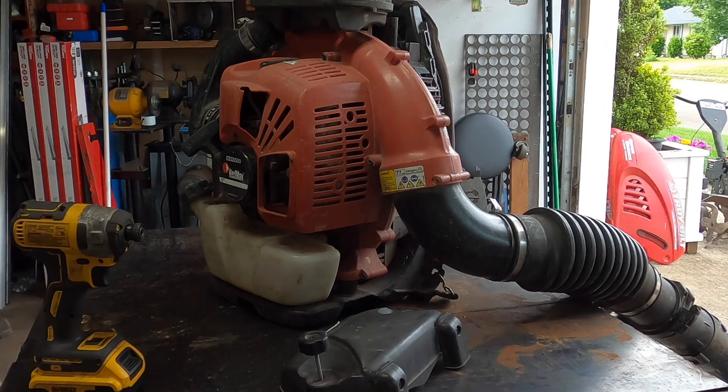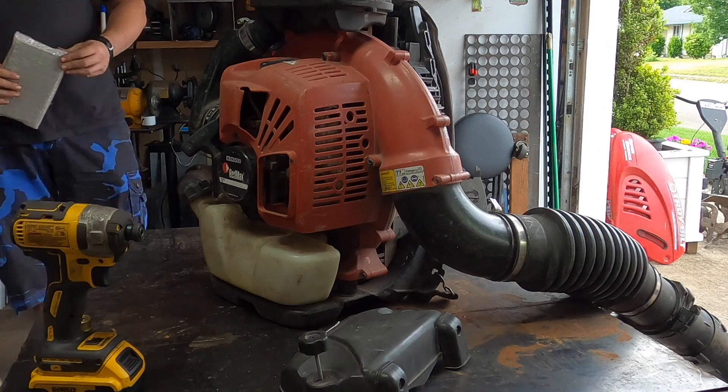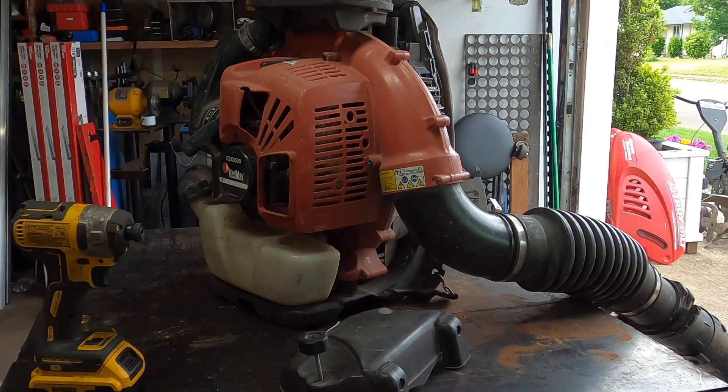A lot of these parts are interchangeable. Really, I think the only thing that isn't is just the plastics around it — it looks obviously different. But other than that, I've replaced cylinders and pistons with Husqvarna ones because I couldn't get the Red Max and they were cheaper. So I'm going to leave you at that. Have a good evening. Follow me on Instagram at SmallEngine101. I'll catch you on the next video.